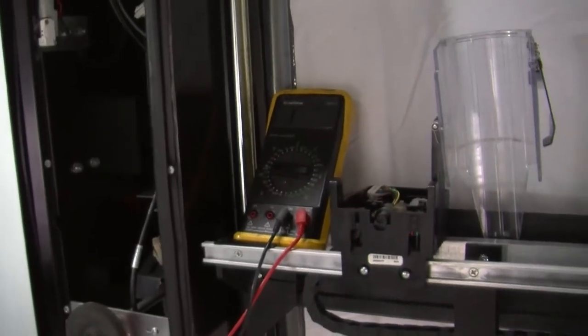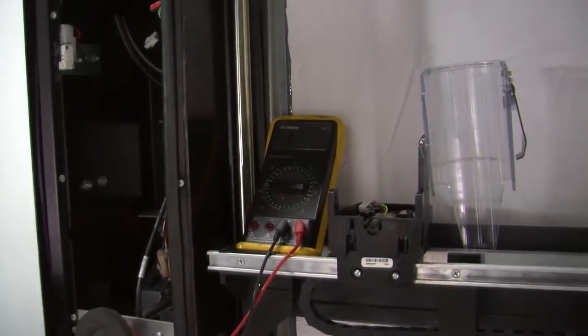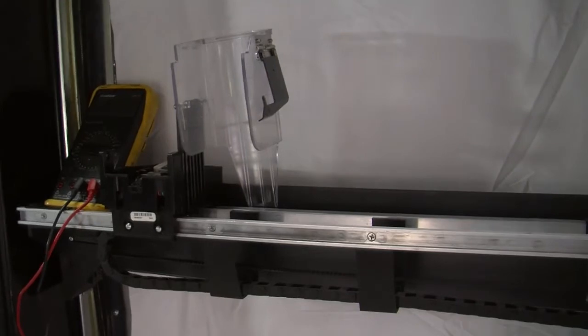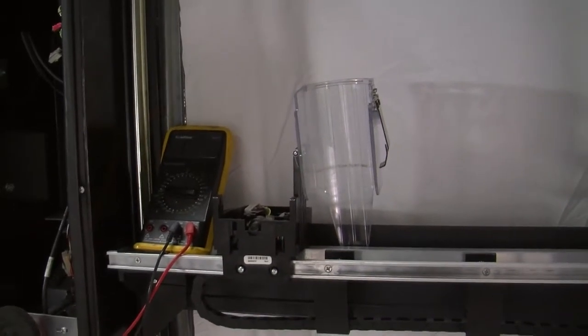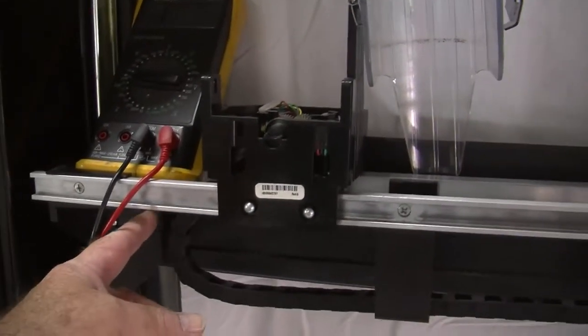That seems simple and straightforward for a broken wire, but there is a condition called an intermittent wire. For example, if you've got a cup that seems to fail only when vending column one or shelf one, simply relocate the gantry to that position and test your wires there. If the wires are still touching in most positions, at the position where you know you have the problem, that's where the wire will be open. Most likely the break is going to be here where the harness flexes, or in the large chain where the harness flexes. In any case, you're not going to want to cut and repair that wire — you're going to want to replace the harness.